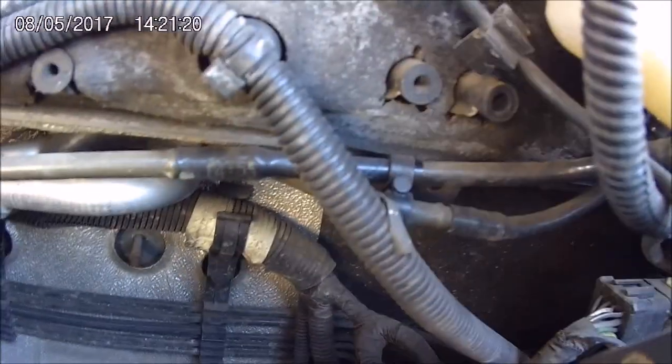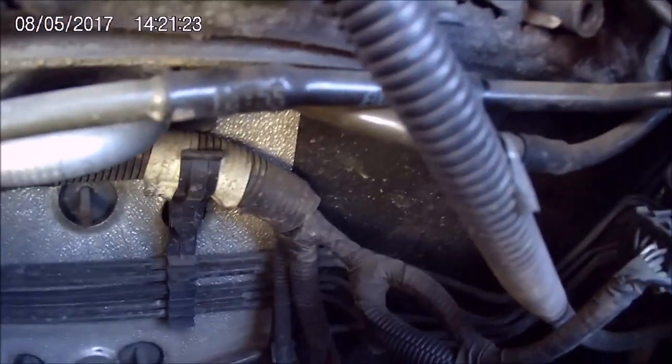You want to lift the lines up. Take the top one out and seal it. Now watch it when you lift it up, because the way it's threaded through the AC lines, it's actually got quite a thin plastic tube and it almost looks like it wants to snap - it's a really funny choice of material. So watch you're not bending it too aggressively. It only needs to be higher than the reservoir just to stop fluid running down. I plugged mine with a rag and then stuck a rubber glove over the top - a little bit seeps into the rag but not a big deal.